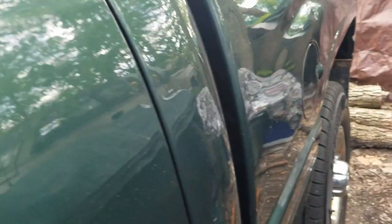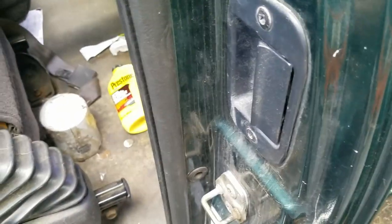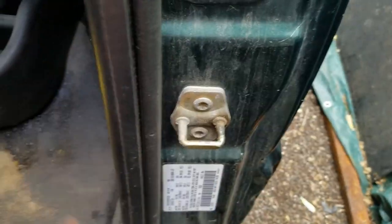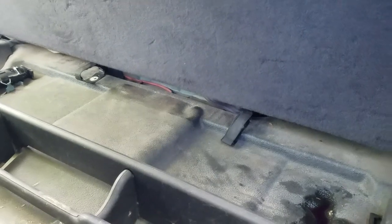Today we're working on Parker. If you know anything about my previous videos, I love the extended cab second gens, but I don't like when the doors don't open. My black truck had the same problem — I had to cut out the bottom latch out of those doors, and today that one opens. We oiled that one really well, and this one we're going to have to peel the door skin away, get at it, remove the latch, and grind it off to get this door open. I did find some new door latch mechanisms for the bottom at the junkyard.